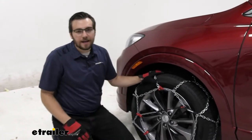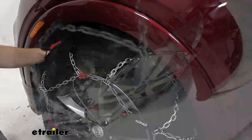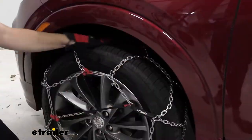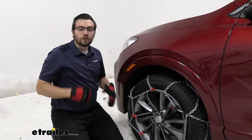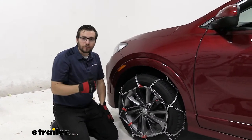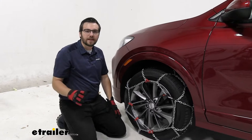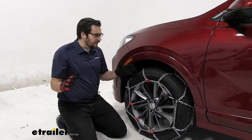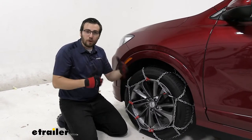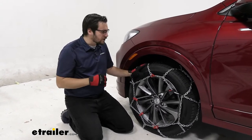You are getting a diamond style pattern on here as well. What that means is we're getting really good coverage on our wheel, almost always having constant contact with our chains, and that's great for biting through that snow and ice. If you're comparing this to a ladder style chain, those have straight horizontal bars that are great for stop-and-start maneuvers — excellent for highway driving. However, you lose a little bit on your turning radius when you go to make left and right turns, having to accelerate to get over those hills and valleys. Diamond style gives you the best of both worlds — biting through snow and ice while maintaining constant contact, making for a smoother ride as well.